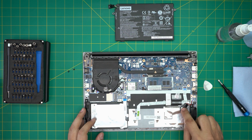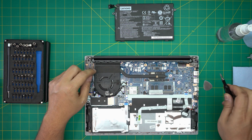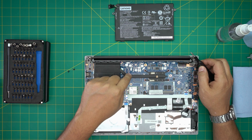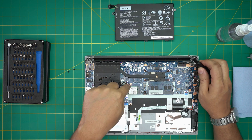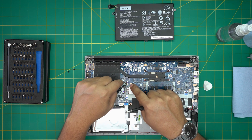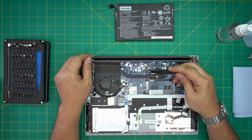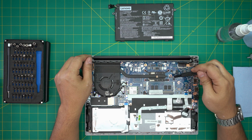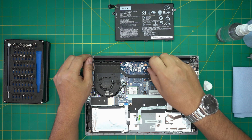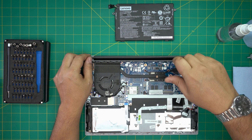Here is the BIOS battery, in case you wondered where it is. Down here we can see the whole fan and heat pipe. There's no GPU in this one, though yours might have a small GPU with an extra screw. We're going to remove the four screws touching the heat pipe over the CPU. The screws have a C-lock so you just need to loosen them.